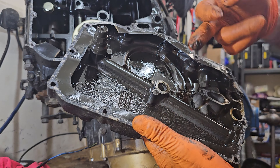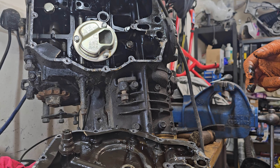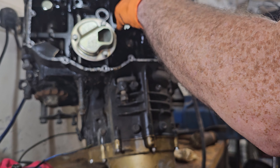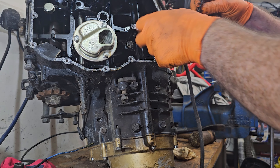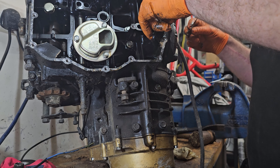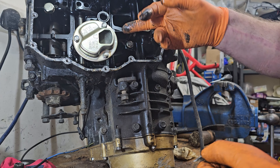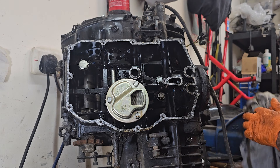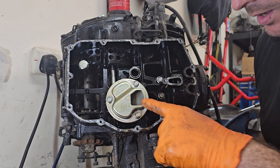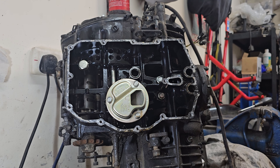Look at that — it's just dried out pools with emulsified oil. The trouble is, we've gone and done what I didn't want to do specifically: we've broken the sump gasket. So we're going to have to buy another one to put it back together so we can start it up. But that looks like you've never seen new oil — it looks brand new. Maybe it was changed recently.